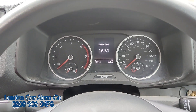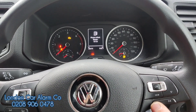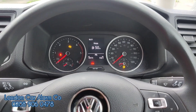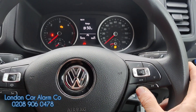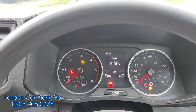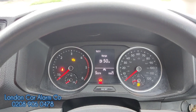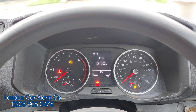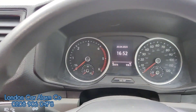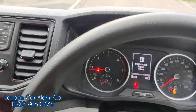If you want to put it in valet mode, main ignition on, insert your code, but on the last press of the last button, hold it — you'll get a flash, then after 15 seconds you'll get five flashes. Tap, tap, tap, tap, one flash, keep holding — you'll get five flashes and it goes into valet mode. Now if you open and close the door and start the van, no code is required.